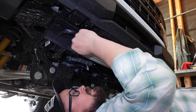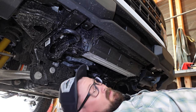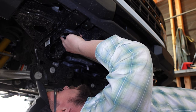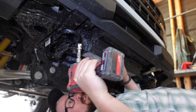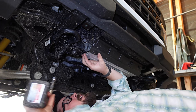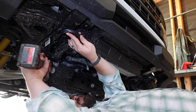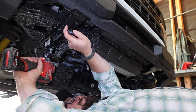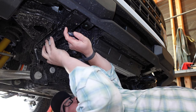Now we're here at the front. We need to pull these tow hooks off. So we're going to take these little rubber grommets off of here. We're going to be saving this hardware — we're going to be using this. Just added an extension and this Milwaukee is cracked out. It's a little frame bolt that's just ripping them out.